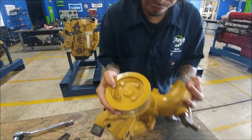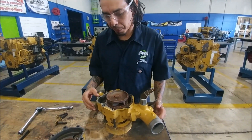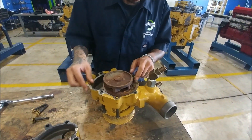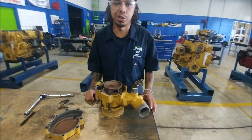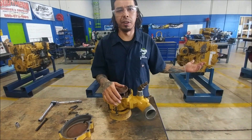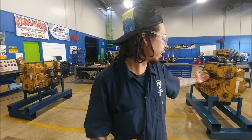Here's basically a water pump taken apart. Honestly, I would replace this unit completely. In here you're also supposed to have a gasket — I could barely even tell there used to be a gasket in there. That would be something to replace and scrape all that out if you were going to reuse this. But since this is a trainer motor, we're going to go ahead and put the back plate back on. Installation is really just the reverse of removal — put the three bolts back in, put the three bolts on the front mount back onto the motor, and you're done. Easy as that.